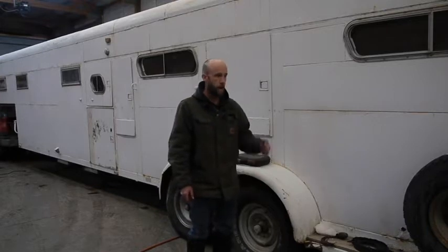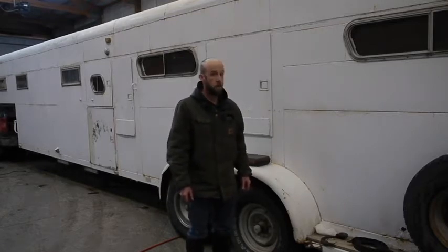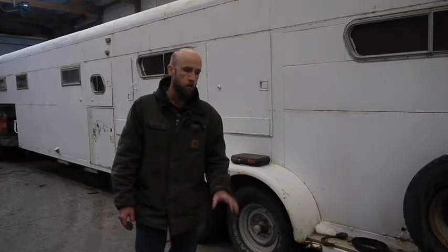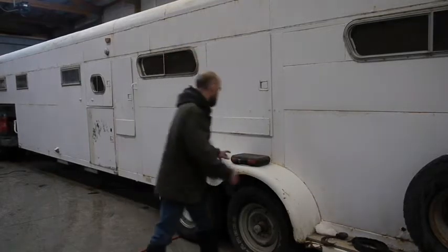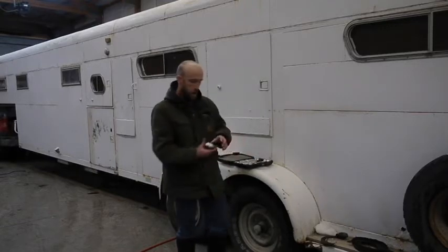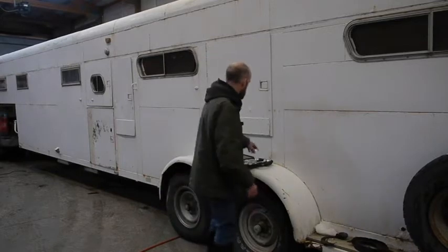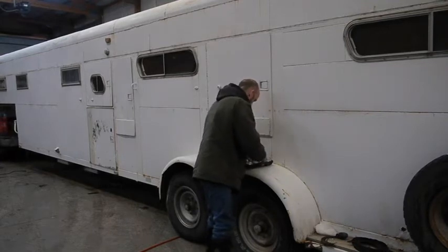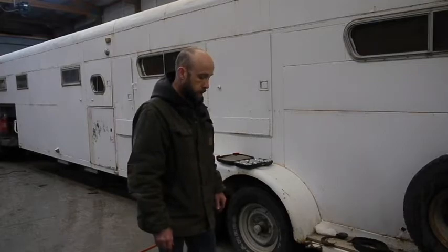I'm going by luck playing with our other little horse trailer. I'm probably going to have to get a whole new axle because I'm trying to find parts for our old trailer — it's not around here. So I'm going to go ahead and start putting the wheel bearings in through the races. I've got my little seal tool — you can drive in bearing races with that. It's just a cheap parts store type, but it has these little pucks. You put the handle on it and then tap in your race.